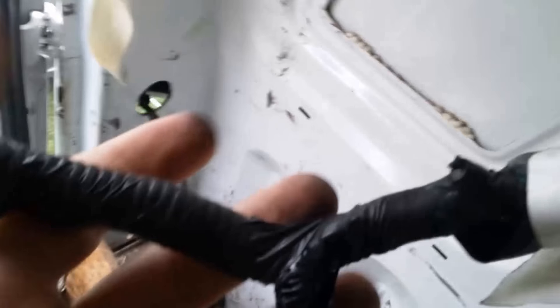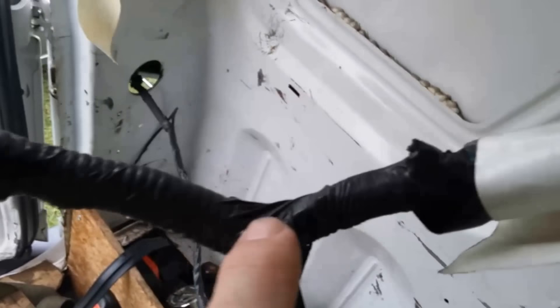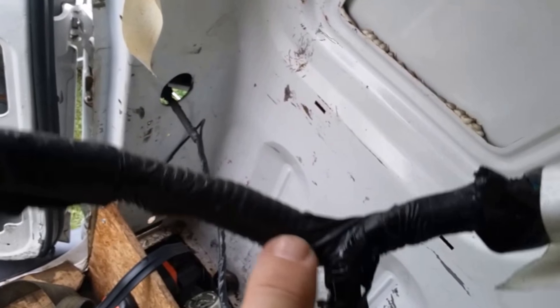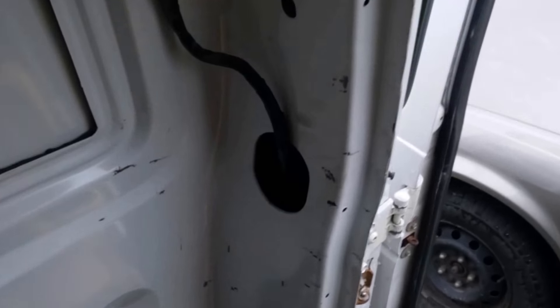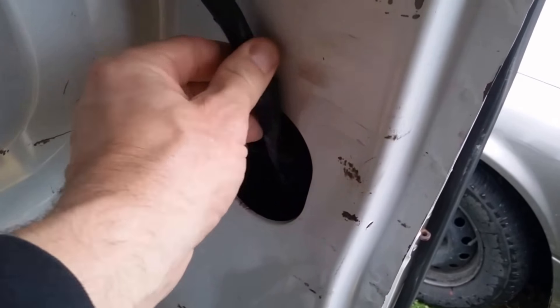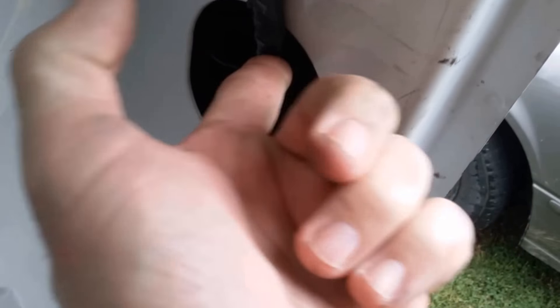So in case you don't have a bad turn signal indicator, you can look for that broken wire. Another place I've seen problems is when one brake light was working on one side but not the other. Right in here where the wires go down - they were fine from one side, but right in here a wire was broken that feeds all the way across. If that's still not your problem, look for grounds in places like right here where the wire goes in and there's an edge of metal - it can get broken there.